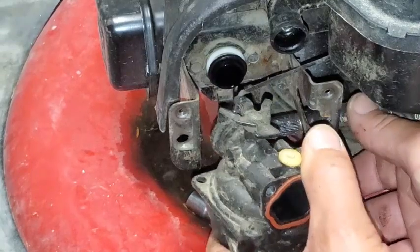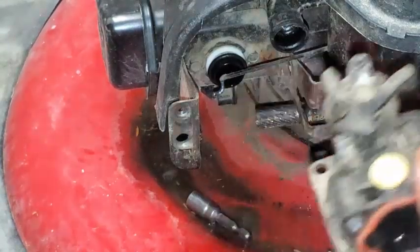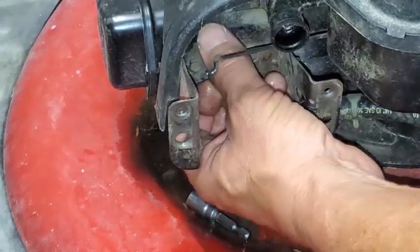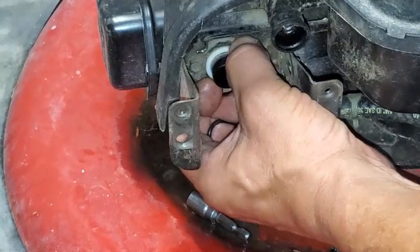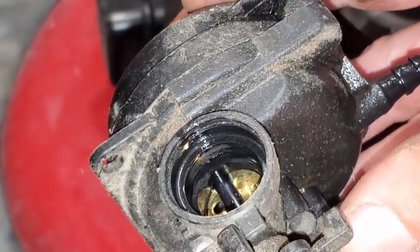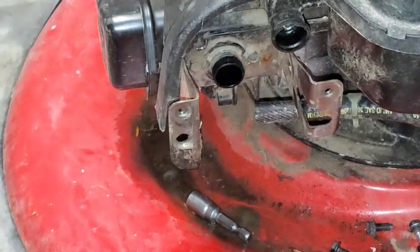Go ahead and pull that straight off. The connection for the governor arm is going to come off and you got it. Now there is a Teflon piece and an O-ring. The O-ring is closest to me right now on this intake manifold — that's the O-ring — and then here's the Teflon piece. This goes back in: O-ring first, and then the Teflon piece. This is draining fuel out and it looks like there might be a little water in there. I don't want to dump it out just yet, so I'm going to set this down.